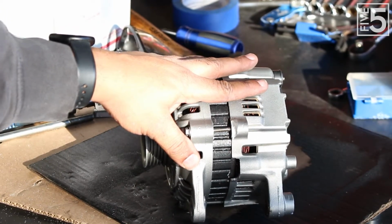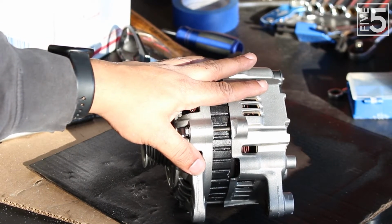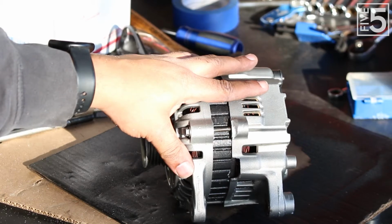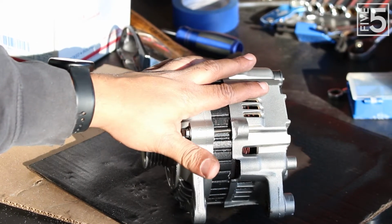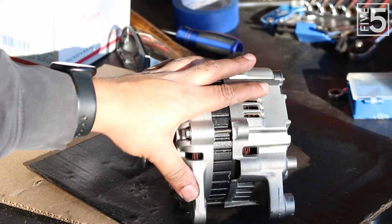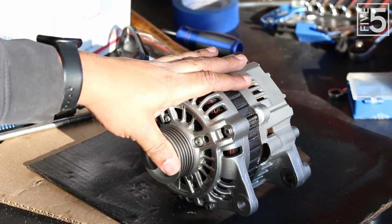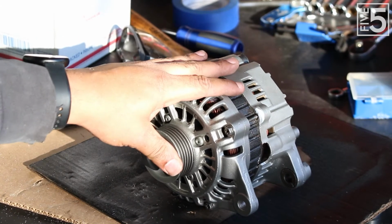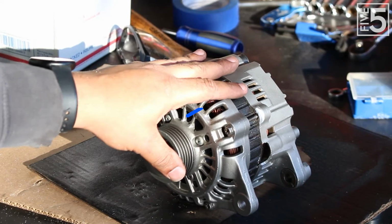With the 4-7 bolt, it is very tight and there is no room whatsoever to adjust it, and the alternator is pretty much wedged up close to the engine block. So I'm gonna see if I can find a slightly longer belt, and then this should be good to go. Next step I'm going to do is go ahead and fit this up to the block so you guys can see how it looks.